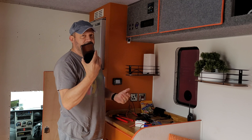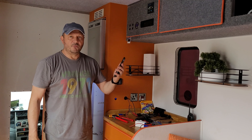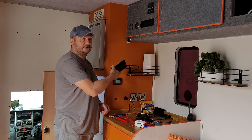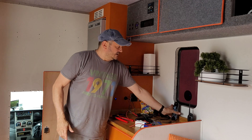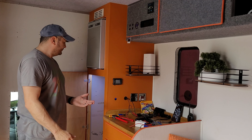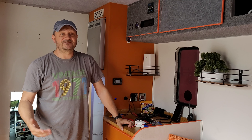I've got an unlimited data package on my phone, so I'm going to use this SIM to go into the router and get a much lesser package for everyday usage. That's it folks — I've got my Huawei 5G router running at a nice steady 12 volts instead of a mixture of voltages like 13, 13.5, or 14 plus. It's now stabilised at 12.08 volts, close to 12.1, which makes me feel a lot better. Catch you all later guys — stay safe.